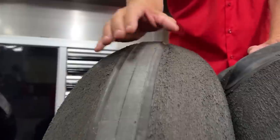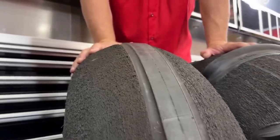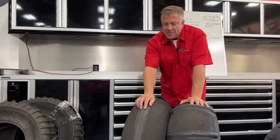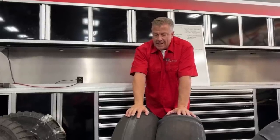Sandcraft has decided to run a shorter razor in the front. The reason is a lot of testing they put into the system. If you have a perfect set of dunes with glass sand and nobody's been on it, you might want a much taller razor because you don't have any chop, chatter, or other tracks to worry about. But in reality 90% of the time you're not going to get smooth sand — you're going to get rough, chopped up, tracked sand. So when you're driving through those tracks, if you have a tall razor, the front will walk and follow other people's tracks. Sandcraft uses a shorter razor in the front so it gives you traction when you want to turn, but when you're inside everybody else's tracks, it doesn't force the car to follow those tracks. It's a middle-of-the-road approach to give you the best performance in typical dune conditions.